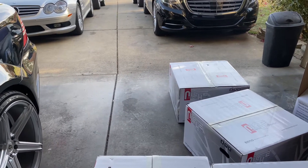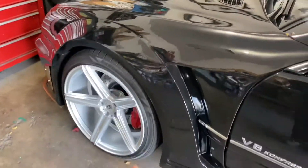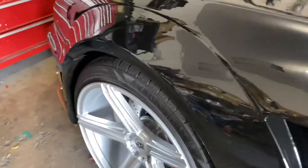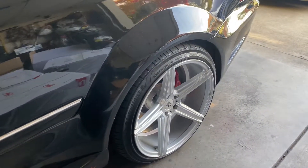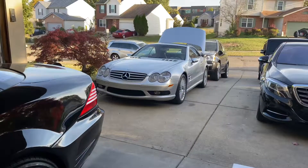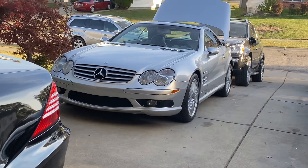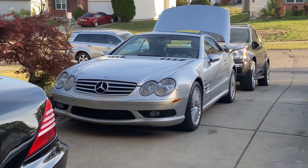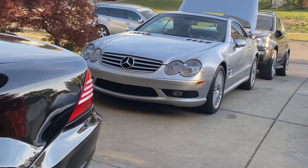It might poke out slightly - you stretch the tires if that's the case, and that's what I do with most of my cars. These right here are 10 and a half in the front. This is a wide body, but I have a 10 and a half in the front with a spacer. In the rear I have 20 by 12 with a spacer. On my factory SL500 I used to have 20 by 10 and a half all the way around and I still put a spacer in the front because the wheel design was catching the calipers.